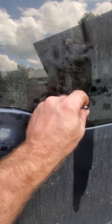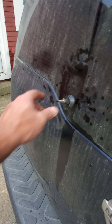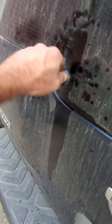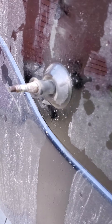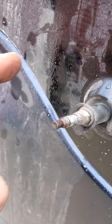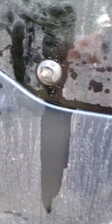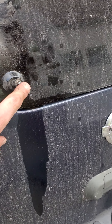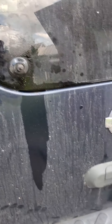That was the 10mm. I took the 10mm off there and the wiper arm did not want to come off — that's not surprising, it's most likely been there for a while. If you look closely, there's splines on this and the wiper arm actually fits over those. So the easiest way to really get it off is to pull on your wiper arm and just tap on the bolt with a hammer. That really just kind of frees it up. Be careful, obviously — you don't want to break your glass.